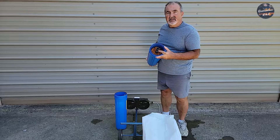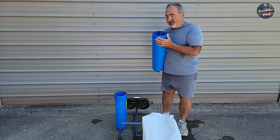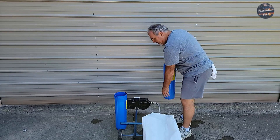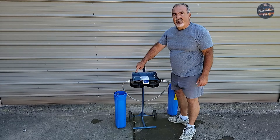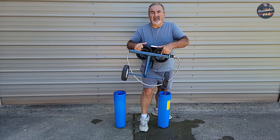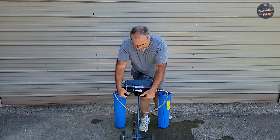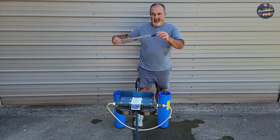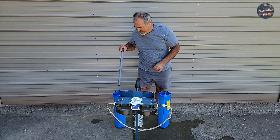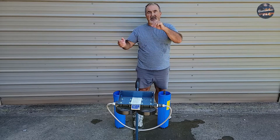It'll look something like this. Where you want to fill the resin to is right here, right below the line. When you fill this up, you would screw this back in. The easiest way to do this one is with your carrier standing up. If you notice, I've already removed the CR Spotless label — that way you know you've already converted it. There's a hole here in the center where that pipe goes. There's a seal there that prevents the water from coming out — this O-ring right here. This O-ring will seat up in there to prevent the water from coming out. You only want the water to go through the pipe, through your resin, then back up and back out.